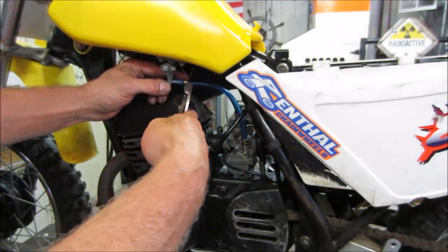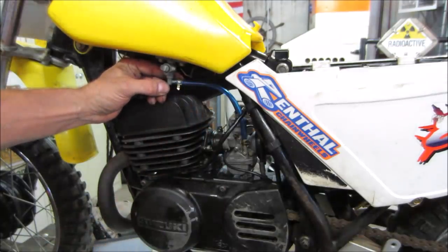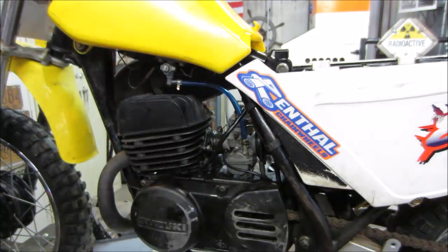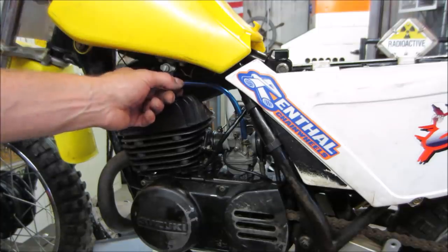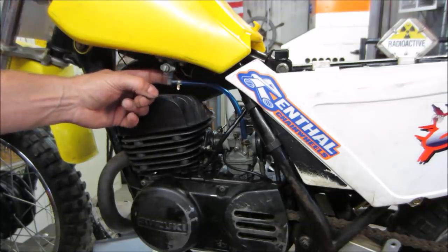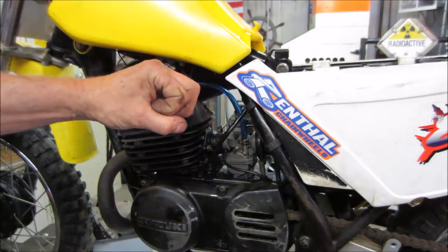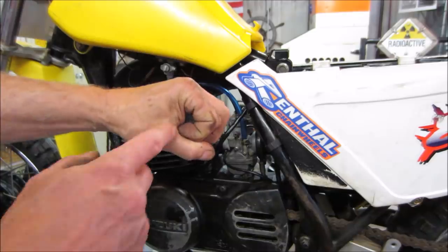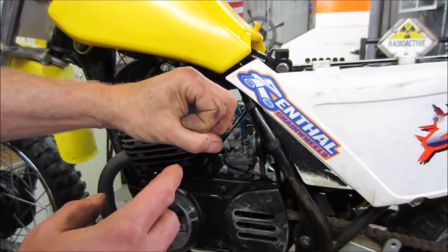It'll get rock hard. Generally, they won't leak. They won't break. They'll just get very stiff, to the point where you've got to cut it off with wire cutters when you're done later on, if you go to replace it. But these clamps hold constant tension on them, and it doesn't crush them out. Whereas if you do a regular hose clamp that has the threads on it, and it closes down to a certain point, the line hardens up and kind of pushes the material out around it, and then it will loosen up and start leaking around it.